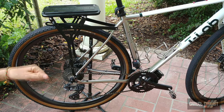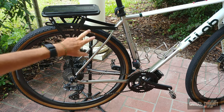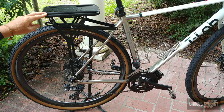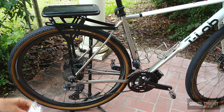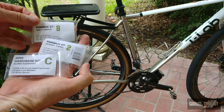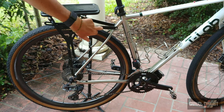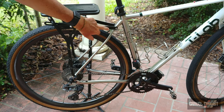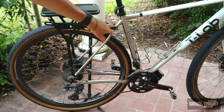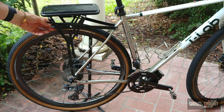Here it is, the Elkhorn rack installed. It was quite a simple installation, though not the most perfect because you really should bend the support mounts a bit more at the mounting point on the frame. During the installation I used hardware packs number 8, number 2, and C. I did need number 3 for mounting the extender to the frame, so I improvised and used pack number 9, which had a bunch of M5 bolts included — no worries at all. If you wanted to save some weight, you could also chop off part of the extender.